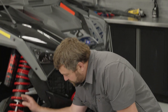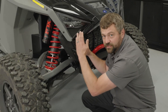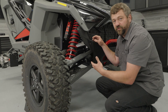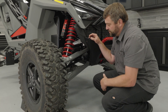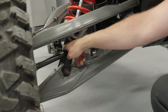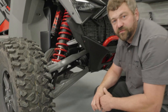With the shock tying into the lower control arm, we get a couple of other geometry benefits. We're able to get a longer shock packaged and lean the shock angle more vertical — closer to a one-to-one ratio of wheel travel to shock compression — meaning we can tune the bypass zones tighter to really dial them in for performance. We also get a better motion ratio inherently in the front suspension design. The lower arm actually straddles the half shaft, so we can center the load on the lower control arm without offsetting it, giving it a really good load path for force distribution.